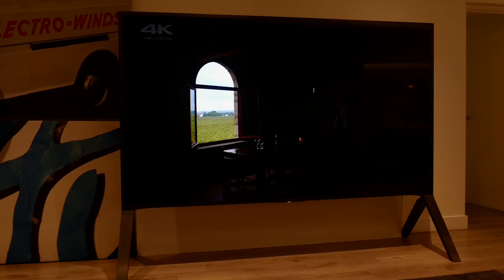For the vast majority of scenes, the black level is essentially almost as deep as a self-emissive display like an OLED television. Obviously in scenes with stars or pinpoint dots of brightness against a black background, self-emissive displays like plasmas and OLEDs can still do better because of their per-pixel illumination control. But still, I think with 1,000 local dimming zones and Sony's fantastic local dimming algorithm and Backlight Master Drive technology, the black level is probably the best I've actually seen from an LED LCD display.